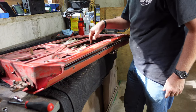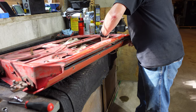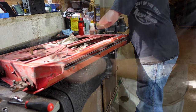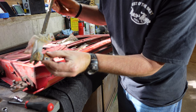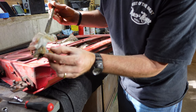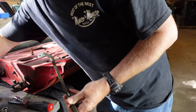Now that's the major weight out of the door, I should be able to get the guts out — the regulator and everything. Got a piece of the mounting bracket over here. See, that comes out relatively easily. It looks like this has been brazed — you can see that piece is supposed to be onto that piece, and there's a little brazing there. I'm not sure if that brazing is factory or not — probably won't know until I get the other door. But that'll be easy to repair. You can see where the plastic has been attached here. I'm putting the screws back in that I took out so I don't lose track of anything.